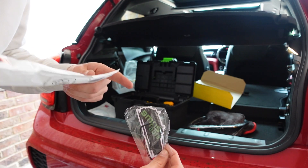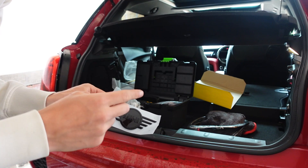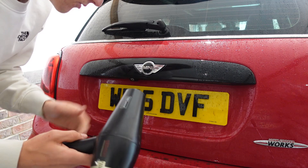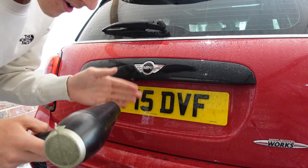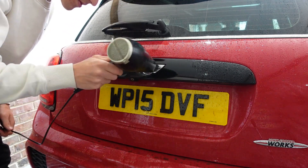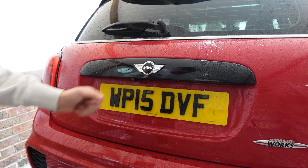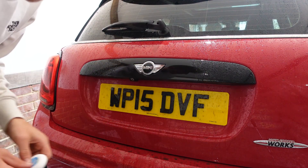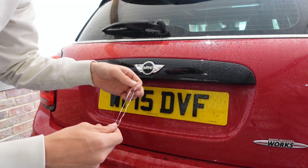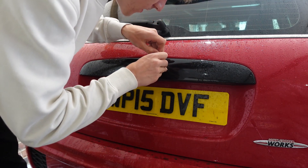I have the mini badge here and it looks like a nice air freshener! These are from SMPS on their eBay shop. I'm going to take the other one off first and then put the new one on. I've got a hair dryer because this will just heat up the glue behind the badge to make it a bit easier to remove. And what I use to get rid of it is dental floss, which is one of those things everyone has around the house.